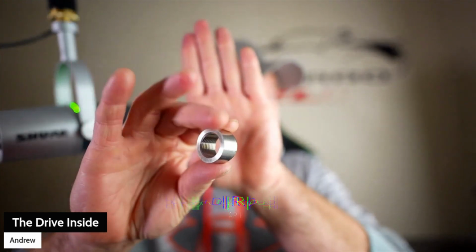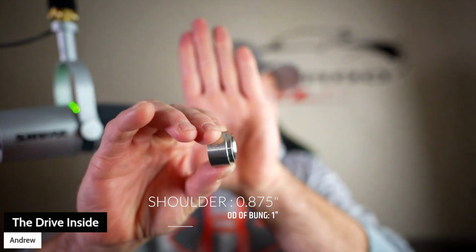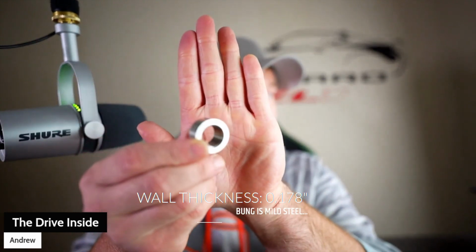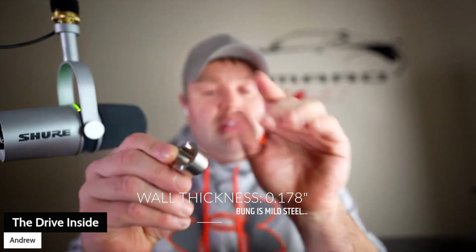You do get a new bung, and I will say this, see that little shoulder? That little shoulder makes it kind of nice because you can take, and I'll show you here just a little bit, you can take a step drill bit, drill your header, sorry, I didn't mean to bump my mic, drill your header, weld it. I'm going to be using MAP gas to heat this up, because if you look how chunky the sidewall is on that, this bung is way thicker than what my header is.